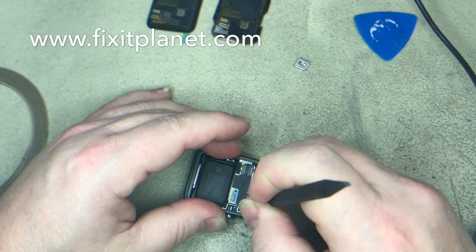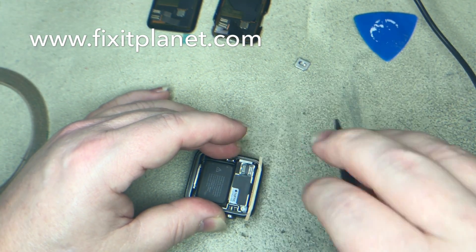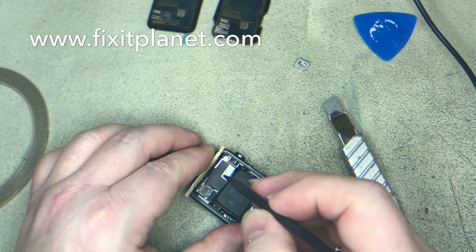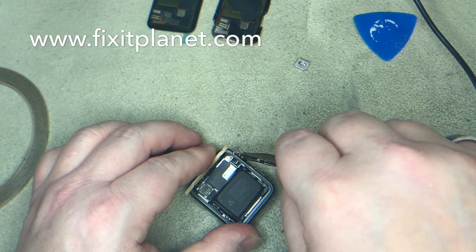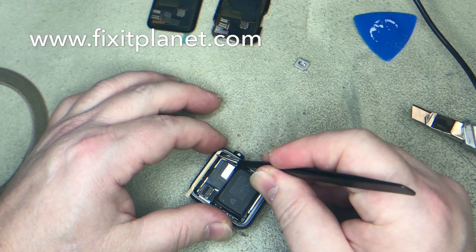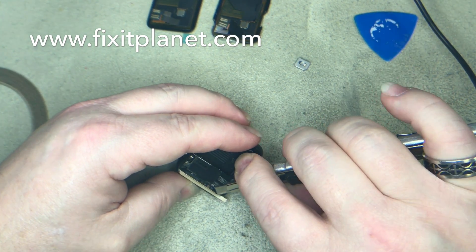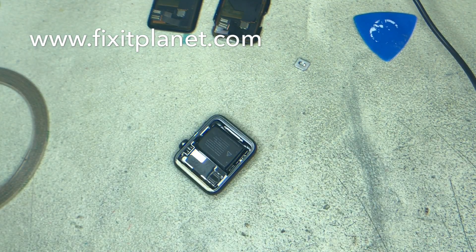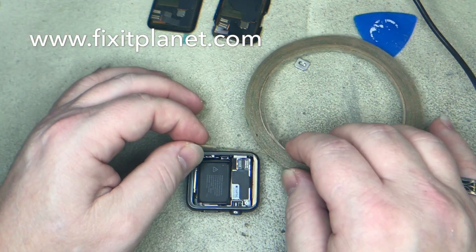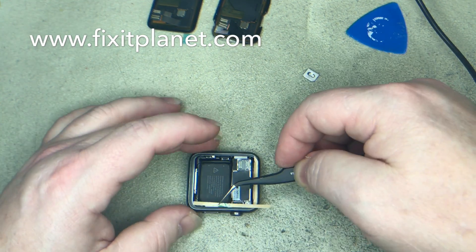This part is a little boring — not that any part of the video is exciting or anything, but this part especially is just me putting the adhesive strips down. When I am cutting my own strips here — you'll notice with the razor knife — I'm not cutting down into the force touch sensor gasket. I'm actually cutting into the inside of the metal part of the watch so I don't do any damage to the gasket. Once we get all finished here, we'll have covered the entire surface all the way around without any gaps.